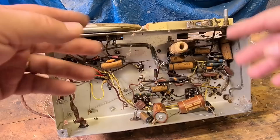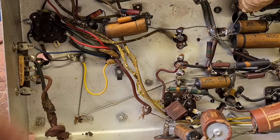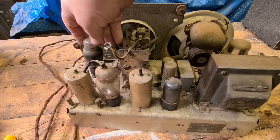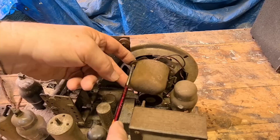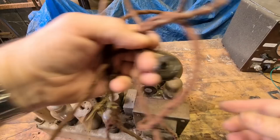Here's the Astor JJ. I've started at the bottom because that's how it fell out of the case. It looks pretty untouched — the capacitors are all there. There is some newer wire in here, so somebody's been in and played with it. I'll turn it over and see what it looks like on top. I'll put the 6A8G valve back with its cap. I need to change the cord — the rubber's just perished — so I'll fit a new one.